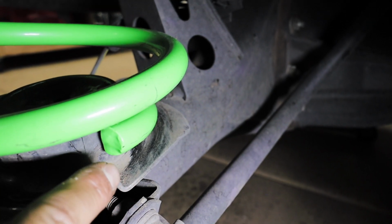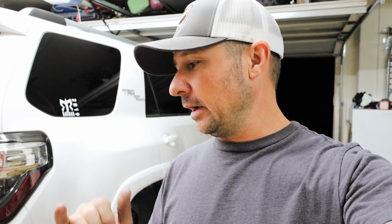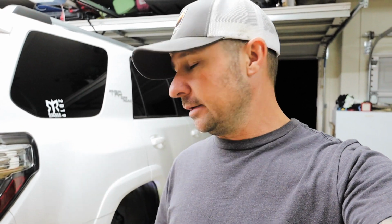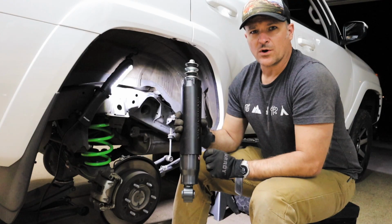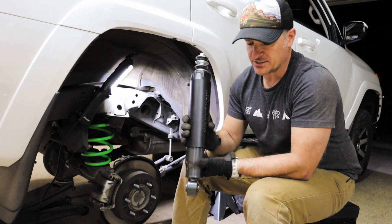So this right here is the notch. Right now we have taken the floor jack and we have moved it off of the one side to create the space. We put it on the center and raised it up, making sure that both shocks are centered in the cups and centered in the bottom, one pinky width away from the flange there. So now we are in the process of reinstalling shocks. So one more look at the Foam Cell Pro shock before we throw it in.